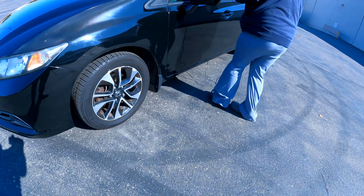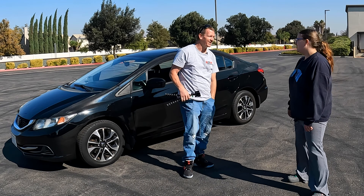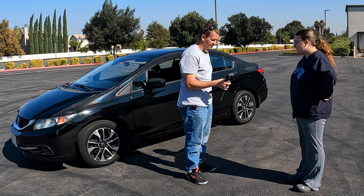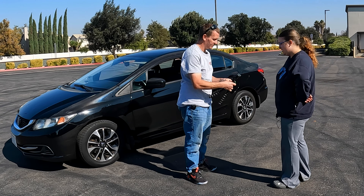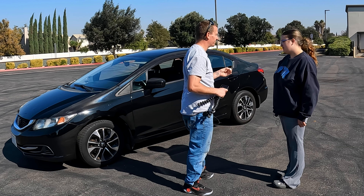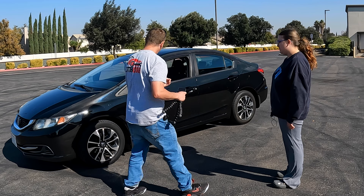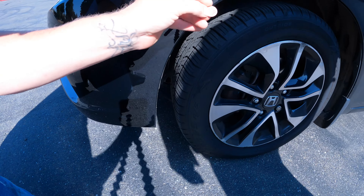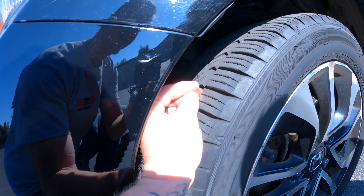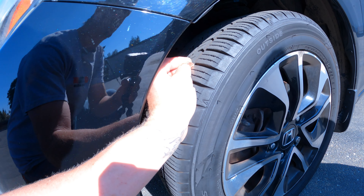You're going to have to go through the passenger side window on that one. I asked you if you had the penny, because that's more of like a tire gauge. If you have a penny — there's Lincoln's head on it, right? That's the person on the front of it. So if on the penny you could see his forehead when you stick the penny in the tire, the tire should be replaced. So if you come over to your tire, get the penny, stick it inside — if you could see his forehead at all, which you can't, you would need a new tire. That's when it's time to replace your tires.